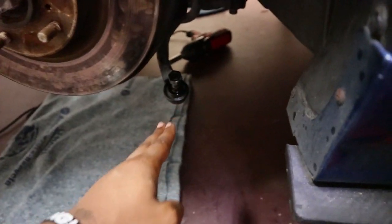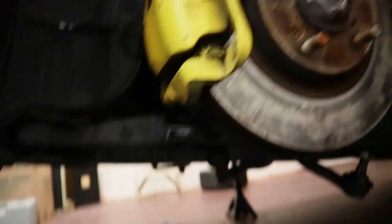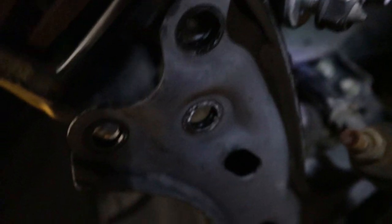I got it out. Using the rubber mallet didn't work so I switched to a regular hammer — it came right out on both sides. Next, you're going to remove two nuts and one bolt to separate the hub or spindle — do that on both sides. Once you do that, you can lift it up or use a pry bar to separate the two pieces.